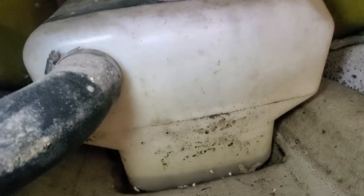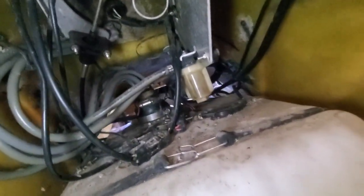As you can see, gray fuel lines — she's all pretty crusty. We do have gas in there, not a lot. We might be able to pull this tank out and get the gas out of it that way. We've got a hose clamp here to undo for the filler neck, all those hoses for the gas lines and filter. It's always a pain because we have to unbolt some of the steering to get back up there where the fuel selector is — just two 13mm bolts, but it's still a hassle. Routing these lines back and doing that loop lets you pull the tank forward and out with extra line.